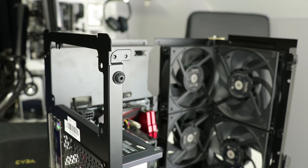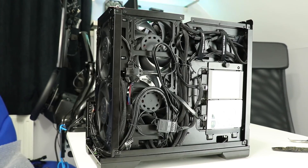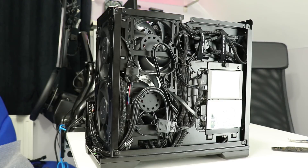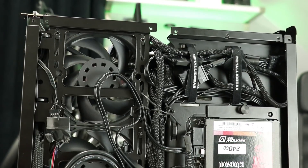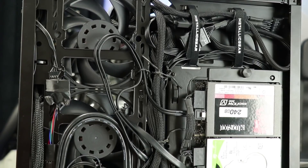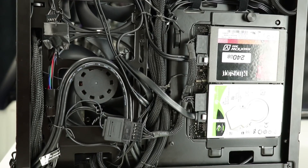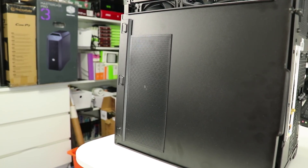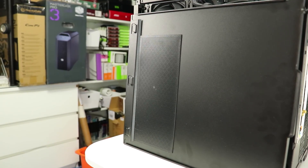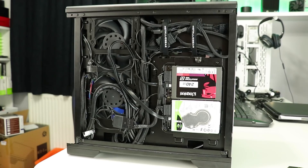Back to the case — the G3 can be thrown into position and I've sorted all the wiring and cable management off-screen. But I almost completely gave up on the two side fan intakes, since the cable management space between the motherboard tray and the side panel is so minimal. I was facing issues where wires behind the fans would eventually get caught by the fan blades. Cable management space is by far this case's biggest problem. After spending an extra half hour reworking cables, I was able to strap them in positions where they wouldn't clip the fan blades — but it was painful.